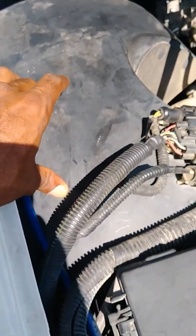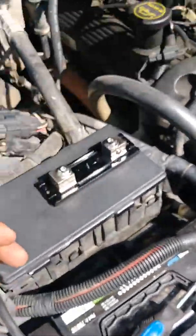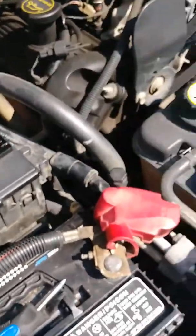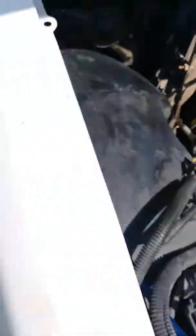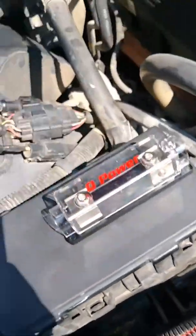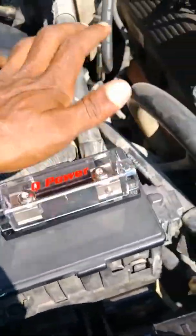One thing — if you're mounting something like this and not mounting it to the wheel well or however your engine bay is set up — what I did before mounting was check my clearance for when I shut my hood. That way I know when I close it I'm not adding pressure down on the fuse box. As you can see with the fuse in there, everything's clear and it won't be hitting the top.